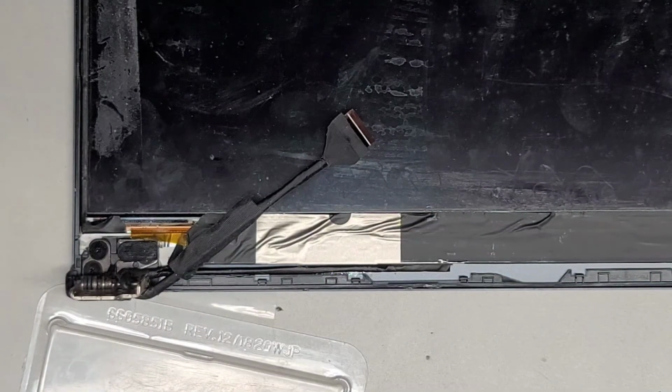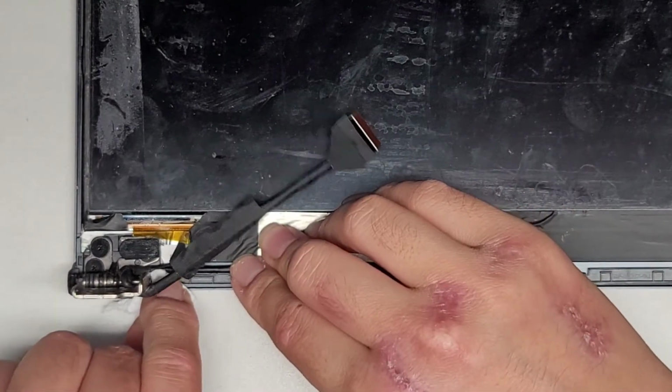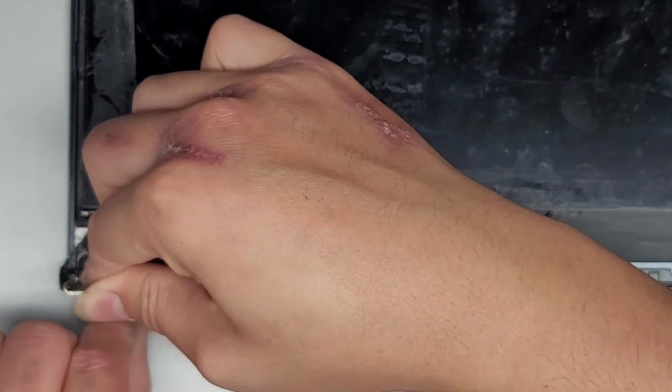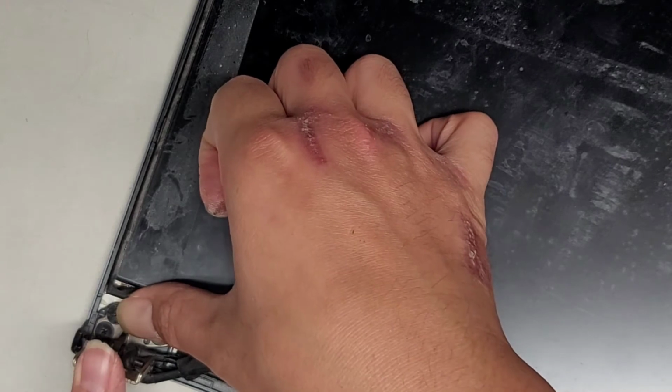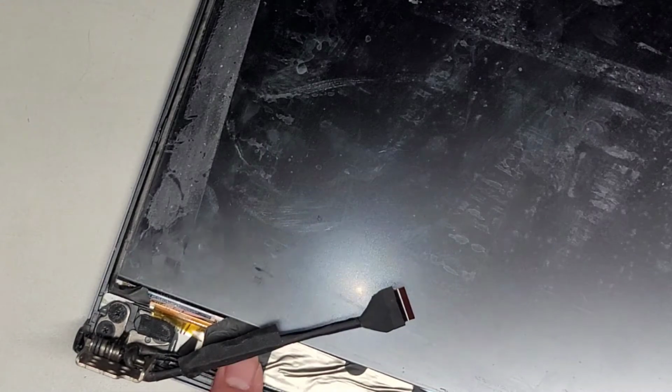If some of it is coming out, you do want to try and clean that up so it's not just flowing out of there. Otherwise you might accidentally glue the bezel down and then you won't be able to take it back out. Alright, so let's see here. This looks okay. I don't see anything leaking out. So you should be good with that side. This stuff will have to sit and cure for about 15 hours, so you are going to have to just leave it like this. You can actually put the bezel on top to help smush it down. But other than that, yeah.